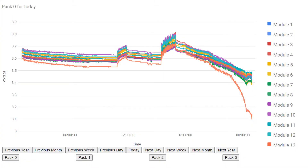You can see from this cell trace — the batteries as they're being discharged over time — that they all hold pretty much together, discharging by about the same amount over the course of the day. But right towards the end you see that sharp drop-off of module number 14; it just drops through the floor. I think it's got a slightly lower capacity than the other modules.